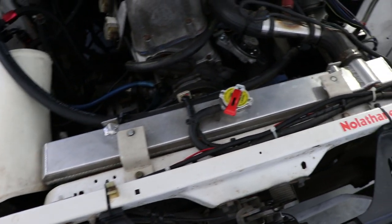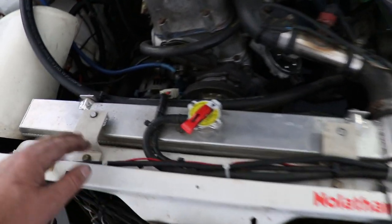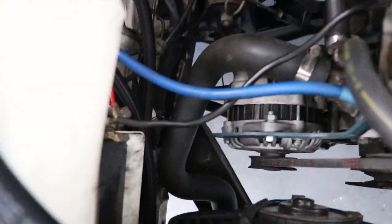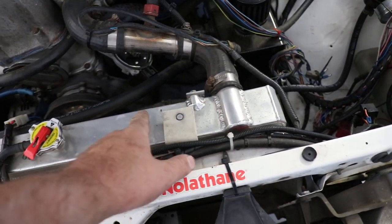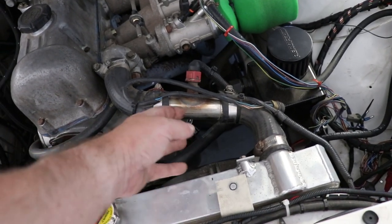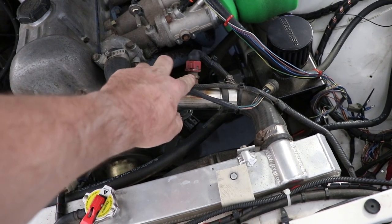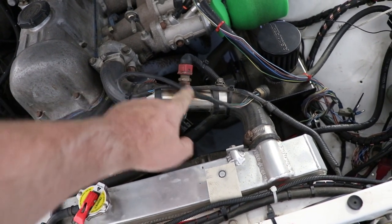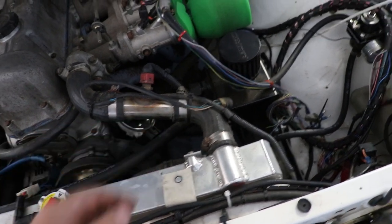Radiator brackets need to be replaced, but the car's coming together quite nicely. I'm running an AF Falcon 120 amp alternator. The radiator sits just a bit further over the top inlet, so simply cutting the top hose and inserting that bit of stainless pipe allowed me to fit that temperature sensor in there as well.